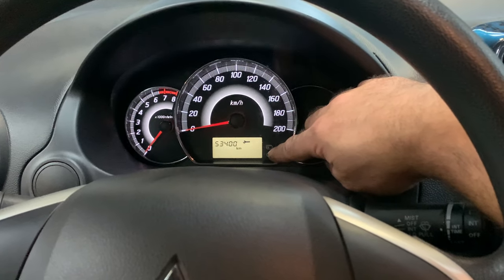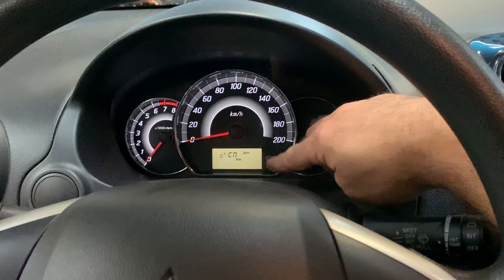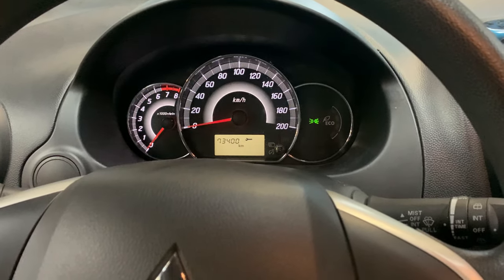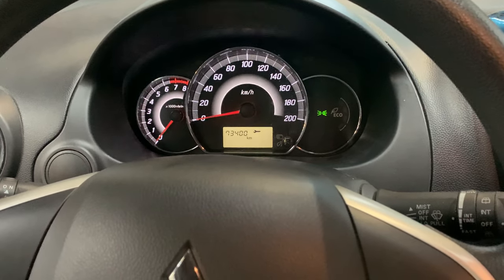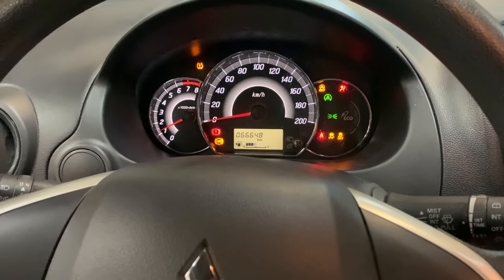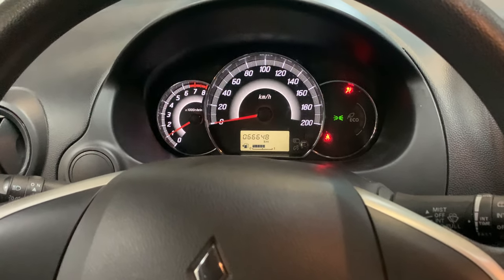Navigate to this area, press and hold it, and it starts blinking. Release and press it again and you'll see 'clear' appears. Once you have done that, the indicator resets the service. Do the check — you'll see that the wrench indicator has gone.